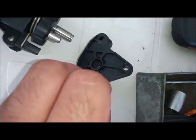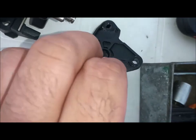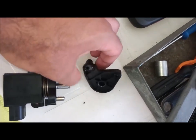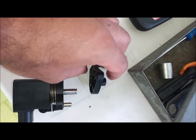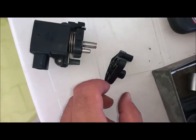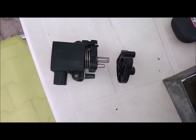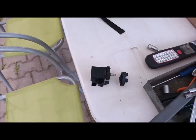When you put the new one back, it will go within those two holes here and here — this mechanism goes to the pedal itself. So it's gonna be here and here. If it doesn't go smoothly, it's because you have to adjust while holding this part with the plate — this plate here holding the spring in its place. Try to maneuver it in and out, keep it in its place, and everything will go well. I'm just sharing experience that's not in any forum, not in any manual, and there are no other DIYs for this pedal sensor — I think this is the only one showing the Mercedes pedal sensor exchange.